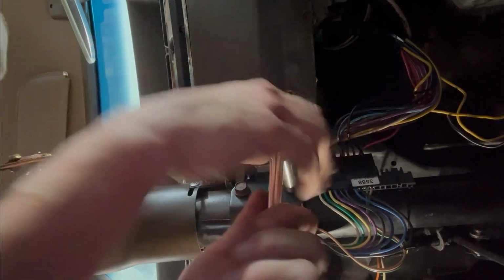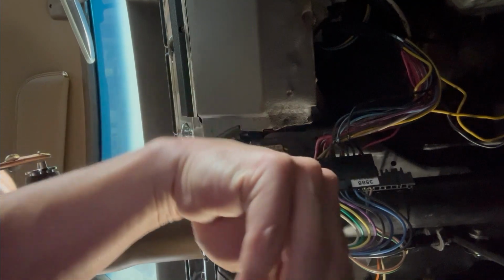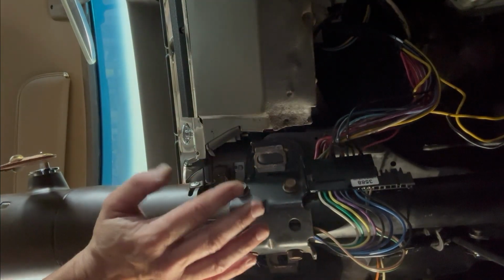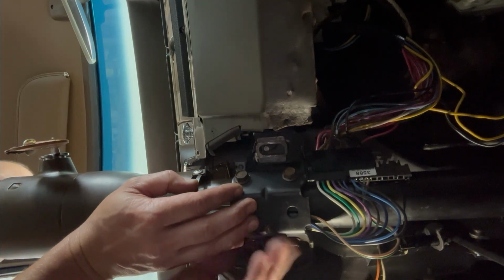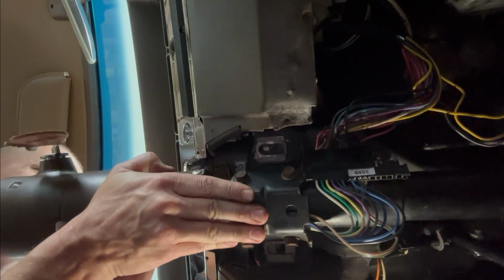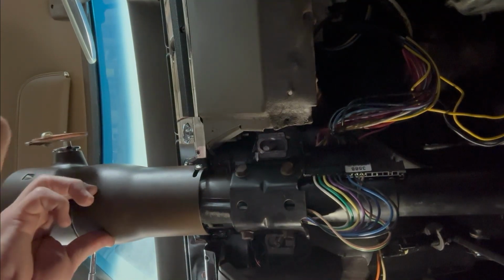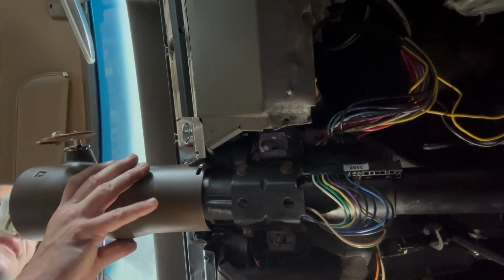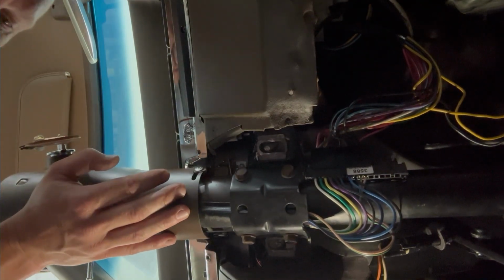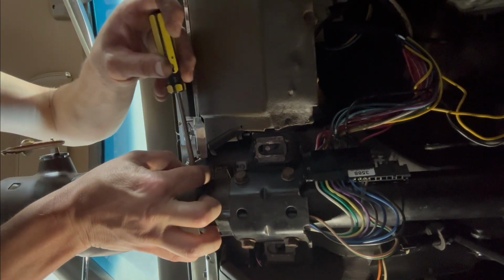Again, try not to put too much stress on your little shift indicator here. It's just literally hanging by the indicator. I think I might have to adjust this little guy once we're done, because it looks like it's pulled tight against the far adjustment. Come on now. Going up in there. How far off are you? There we go. Oh! Now all the way up. Yeah, I definitely need to adjust it. Yeah, we need to bring our adjustment down on our indicator a little bit.